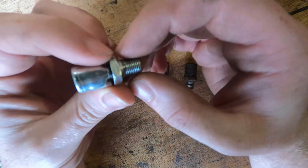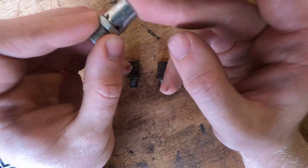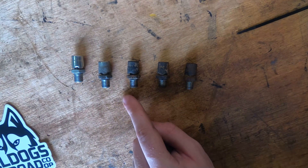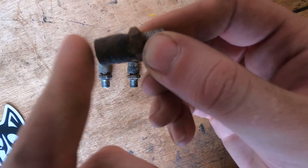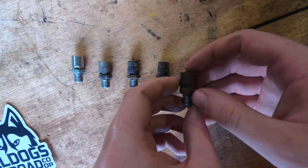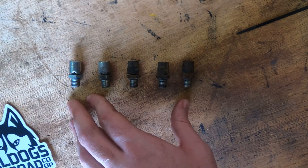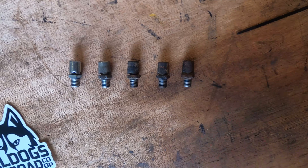You can see here, this is a brand new, fully functional breather. It will regulate the air so that it doesn't build up too much pressure and your axle seals stay in good shape. Now, as your truck starts to get older, rust starts to build up, and they slowly get a little bit rustier until the unit completely seals shut — you don't get that movement anymore. What happens is pressure isn't allowed to be released, so pressure builds and builds until the next thing to go is your axle seals, and that's a very expensive fix.